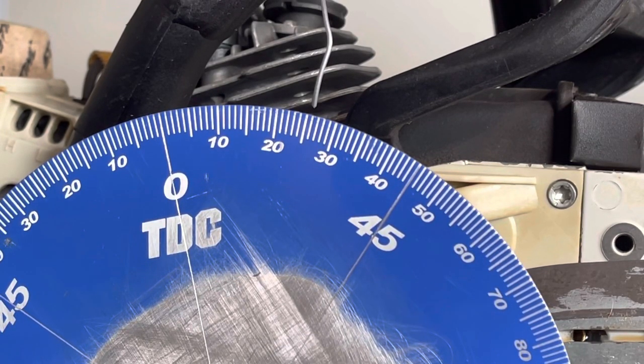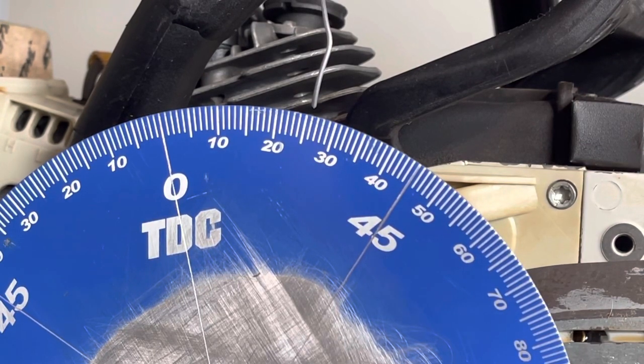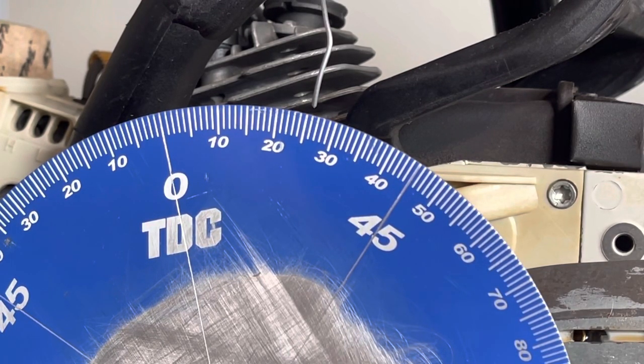You've got to be careful because if you advance ignition too far, it's going to want to bite you. When you're pulling that pull cord, if it rips it out of your hand, it's just telling you that it's sparking too early and fighting against the explosion inside the engine. So if that's the case, retard your timing and you shouldn't have any issues at all. The newer machines generally have ignition advance built in - you'd find that at idle it would be around about 26 to 28, and then at wide open throttle you might advance by three or four degrees, giving slightly better performance up at 13 to 14,000 RPM.